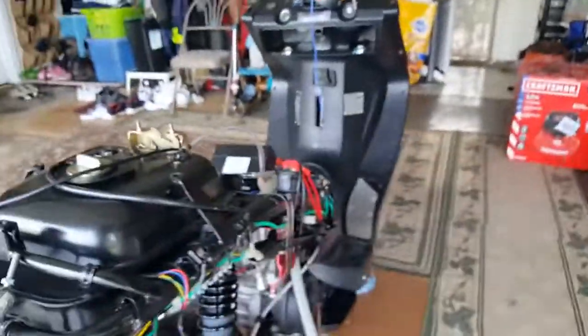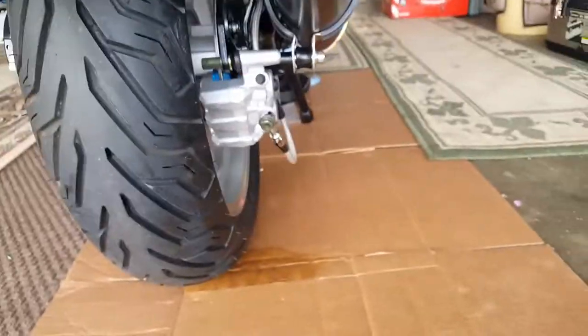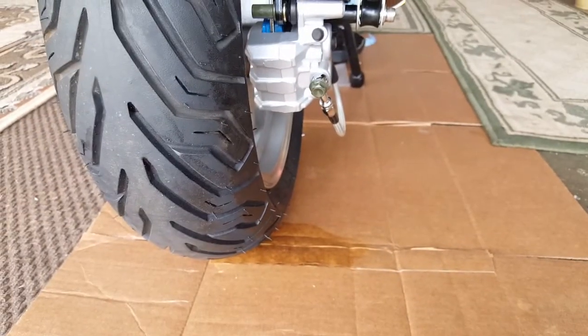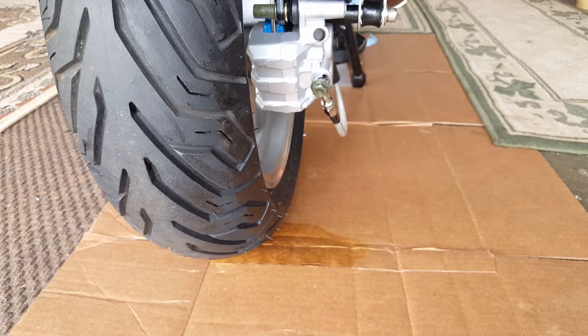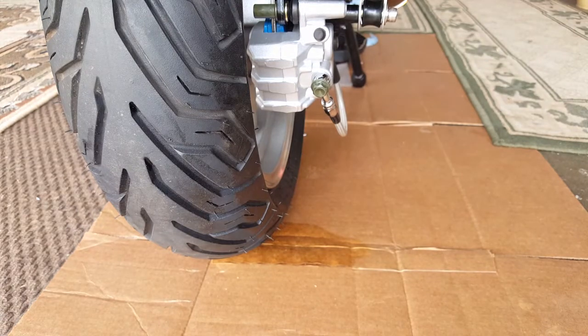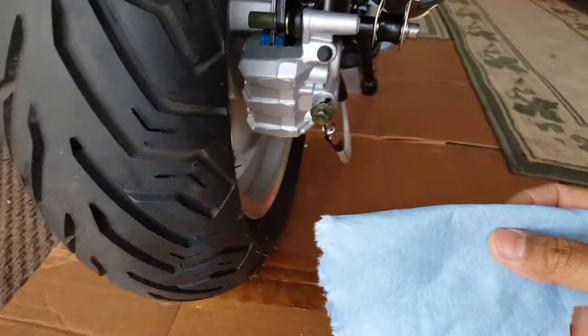But for the meantime, let's figure out how to even get our brake fluid from not dripping, right? It's still showing a little mark here, so let's find out where that mark is again. Everything's pretty much replaced already, so I want to see what's the hold up on it. All right, I'm going to rip two sheets out here cleanly, make sure they don't have any marks on them ahead of time. Okay, so here we go, dry as a booger.